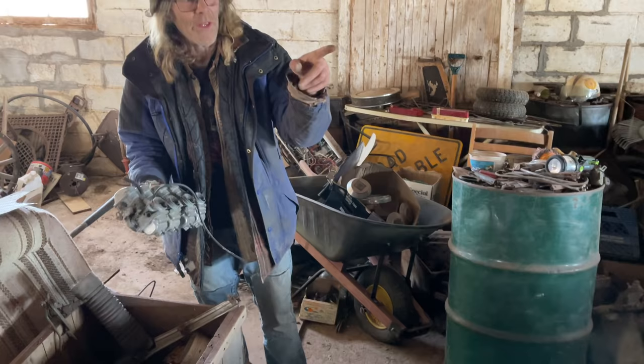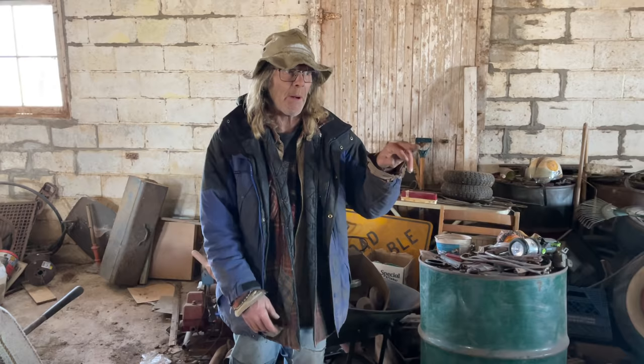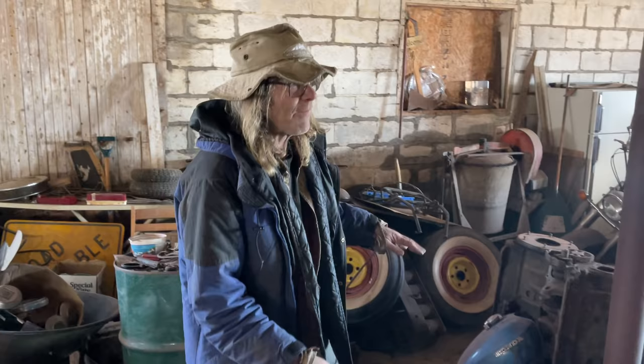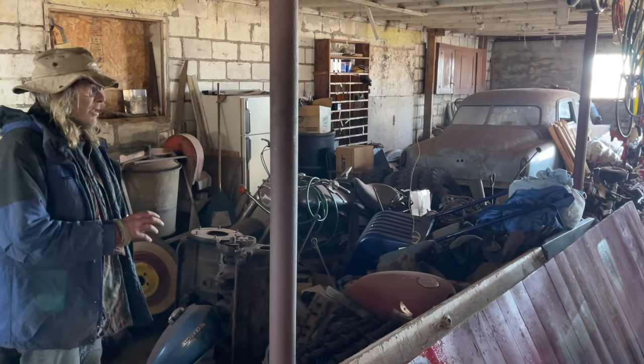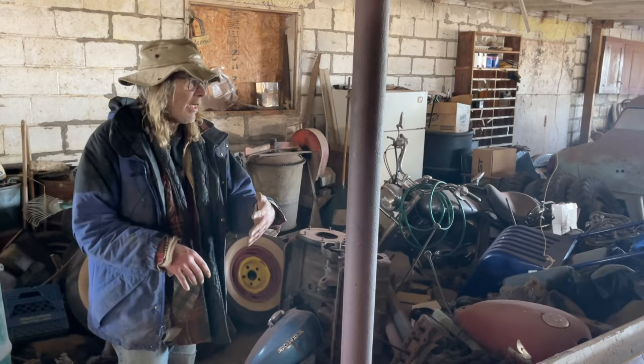They're a little bit smaller than the 900, but the guy bought all new parts for the carburetors on that. So when you take them apart, they should still be good, because that's a major part of the tuning. But do not run the motor until you take the head off and make sure. I'm not gonna run anything. I'm probably just gonna leave it for now. No, because it'd be drastic if you started it up and the chain thrashes and breaks and puts a hole in the block or something.